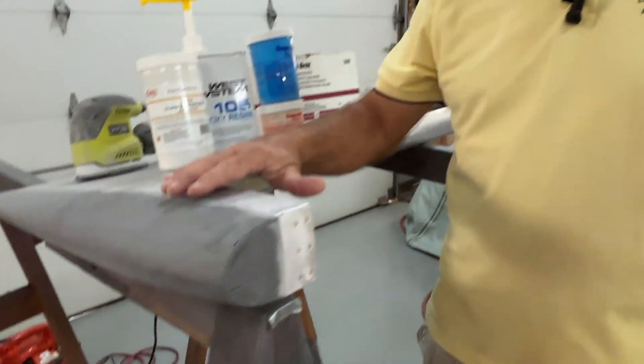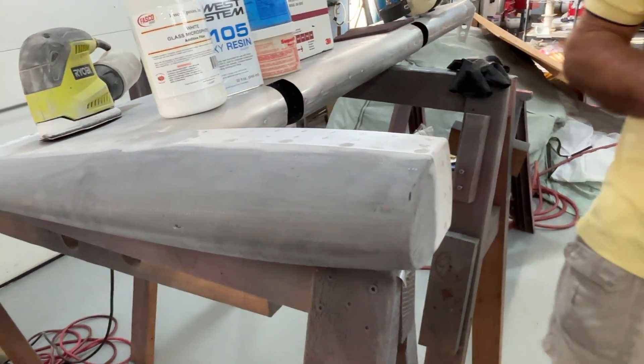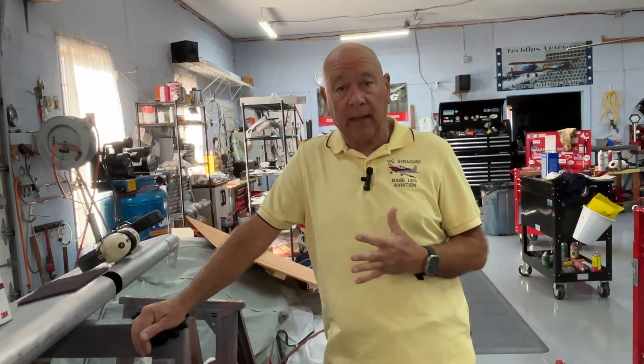I'll put the primer on and then may need some high build primer on the carbon fiber tips and where they mate. If so, I'll probably use Evercoat 2K Primer — it's nice and hard and doesn't shrink. Then we'll sand everything down to maybe 600 grit, Scotch-Brite again, and begin the paint process using Imron. I'll be using Corlar Primer over top of the Direct to Metal Primer, and then Imron paint — I think we're using AF500 this time.